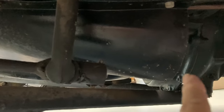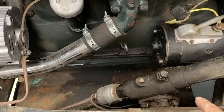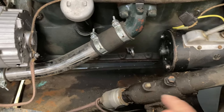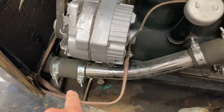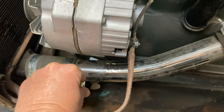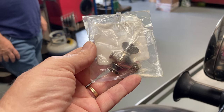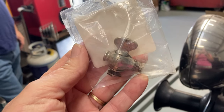All right, we're going down. On the driver's side, that is the splash pan right there. It goes up and tapers toward the front of the vehicle. From the engine area, you can see this whole metal piece — that's where it drips down to and goes out. Here is the petcock, which is flat right now. You just turn it so it's long ways and that will empty the radiator juices out. Here is a petcock that has not been opened yet — brand new.